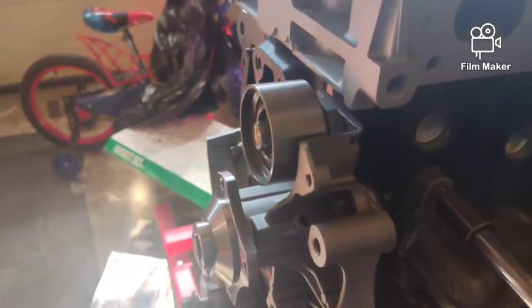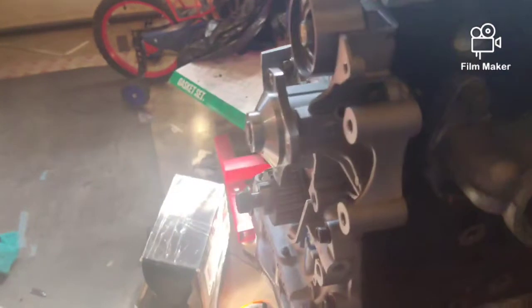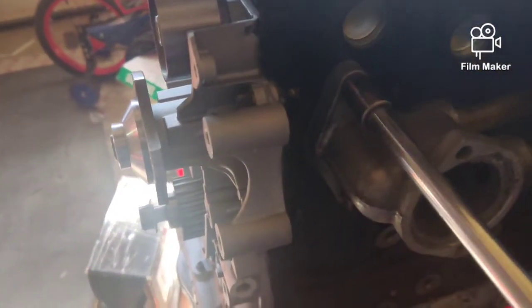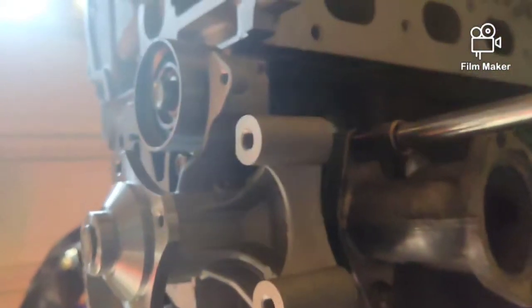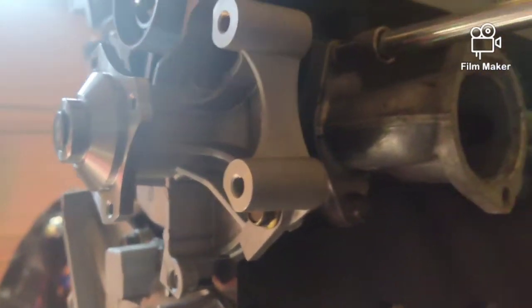Okay, so we have our 2 bolts here and down here. We're going to run them in just with the electric impact. Oops, got it going the wrong way, y'all. Well, that's why I said I keep everything legit. When I mess it up, I'm not afraid to show y'all. So we got that sitting back in there. Gonna run this down. Same thing on the bottom. We're gonna get them snugged up, and then I'll hand tighten them down. Alright, those are good and snug. Those shouldn't go anywhere. Now we'll get the pipes secured to the block, and we'll put the thermostat in it.